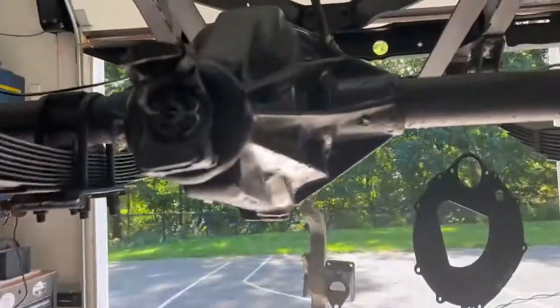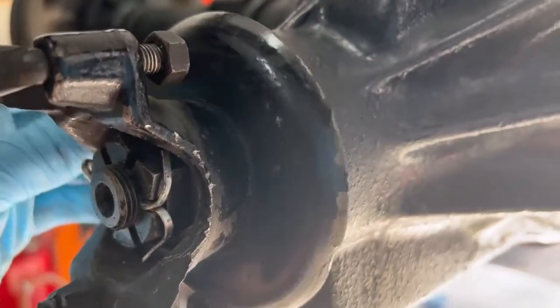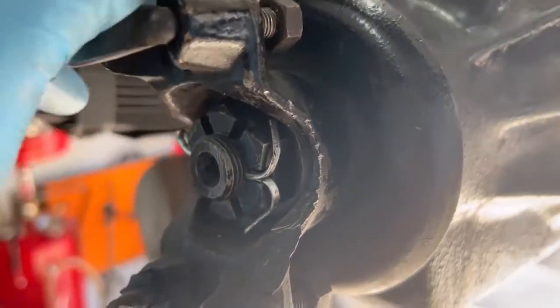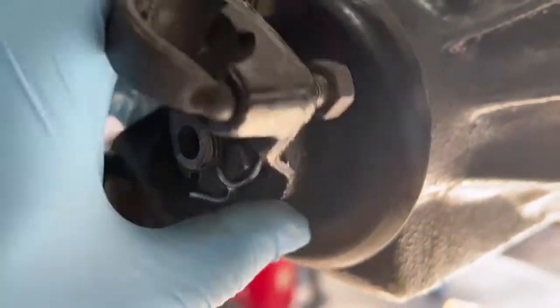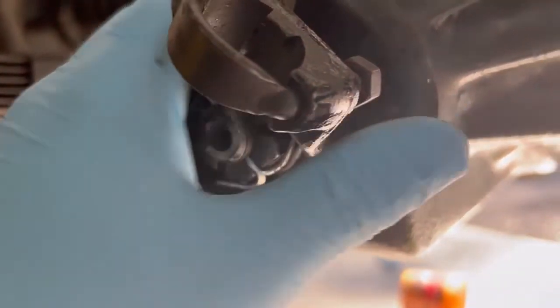Let me take you back here to the rear axle. What was happening with that seal with the red on it — that aftermarket seal — this piece here was getting bound up. I couldn't move this freely; it had some real drag on it when I was moving it. This has all been torqued down to spec, cotter pins in. But again, these pieces weren't moving for me — things were binding up. So there was definitely an issue with that seal.